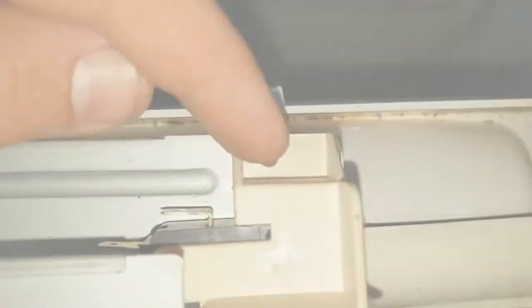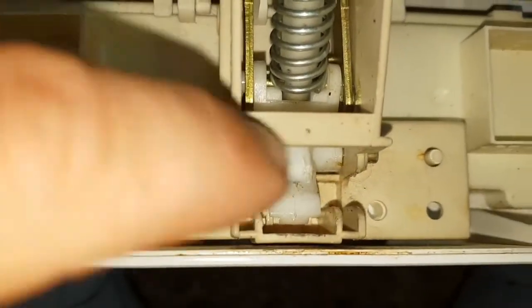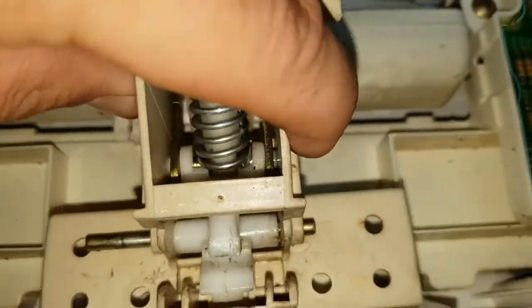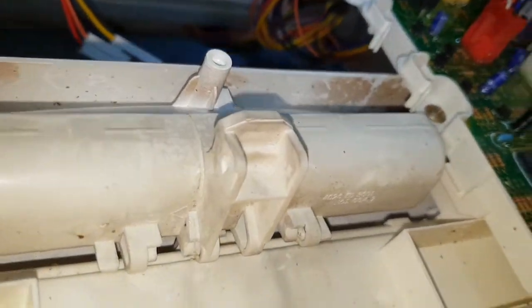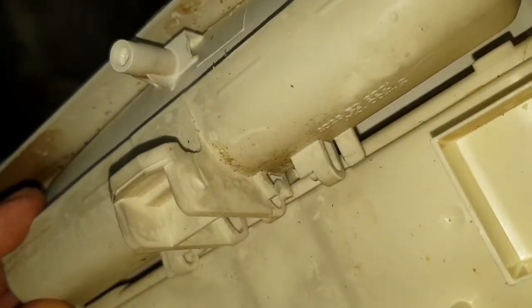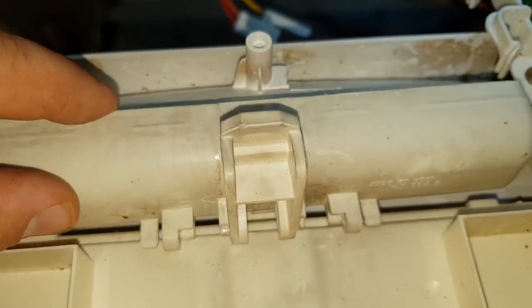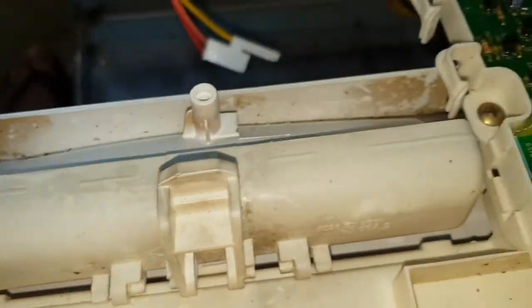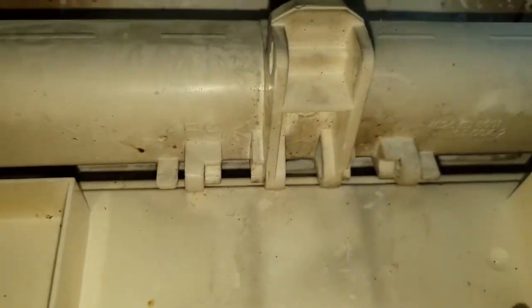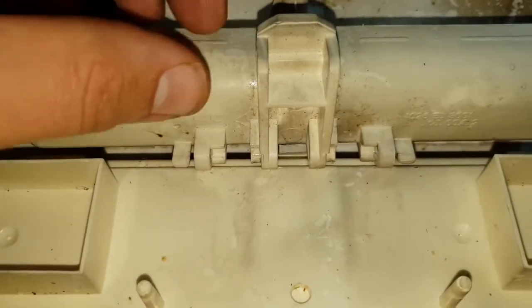There's a copper screw on that side. I pushed this pin out with my pin punch, took out two screws, and now this whole unit comes loose. Now we can see the latch that presses onto that micro switch, and on the sides there were two little nobbins that went onto these copper plates at the bottom - that is now loose. That is what pressed on the micro switch to tell the door it's open or closed. So it's a mechanical failure.